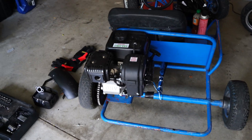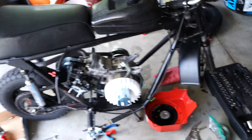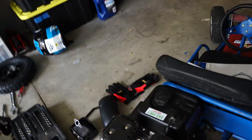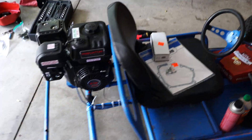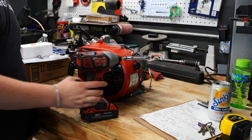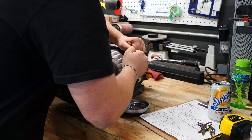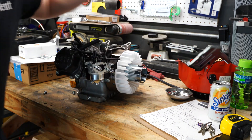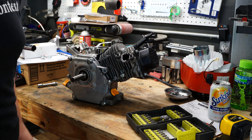That's a controversial opinion but we've proved it's true. This motor here with the centrifugal clutch, however, will blow up. So because this 224 is fully ungoverned, we have decided to add some billet parts. I bought a new rod, and the flywheel will be here in the mail tomorrow. We're going to do that today. This is pretty much like a routine at this point - let's just start tearing it down. Time to drain the oil.